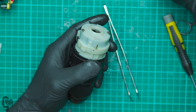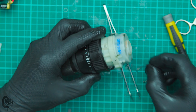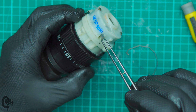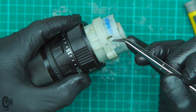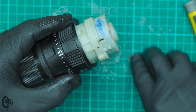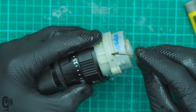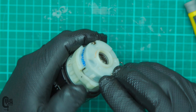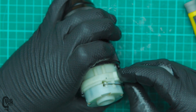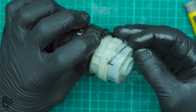It's all looking pretty good so far. Last thing to do is to clip in the little speed selector ring. You might have to turn the gearbox upside down. If you look really closely in that gap, you can see there's a little ridge in one of those ring gears, and these little wire ends have got to clip into that little ridge. That side is in — turn it over and clip the other side in — and there we go. It is clipped in. It is a little bit easier than maybe what it initially looks, but we are all now good to go.